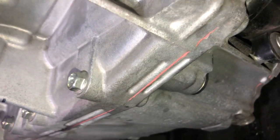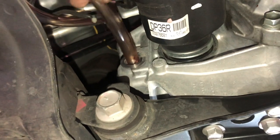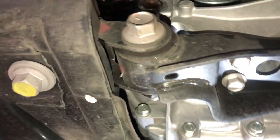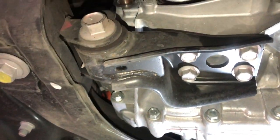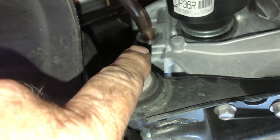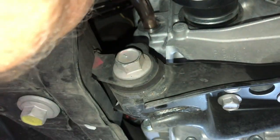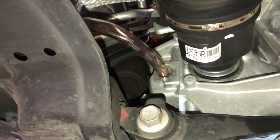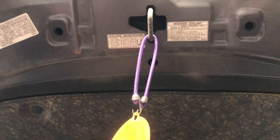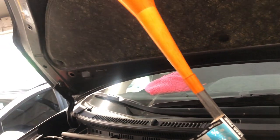I'm going to lower the car down and get my tube set up to fill it up. Here's my tube — I just drop this down from above. The key to this is to just put it into the fill hole. When you fill a transmission like this, these are exactly like a manual transmission — you fill and when it's full it'll start dripping out of the hole. I can fill from above using gravity. A hand pump is a real pain to use, so this works much easier.